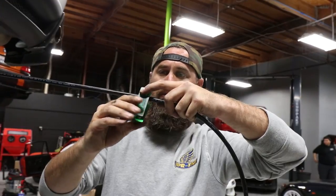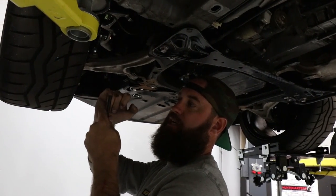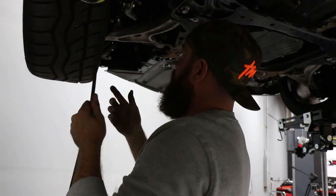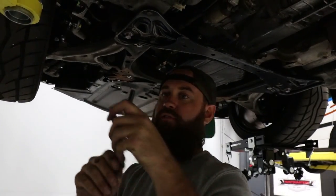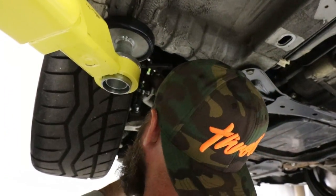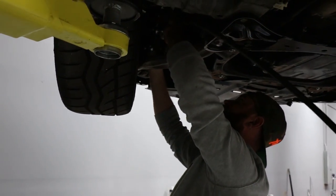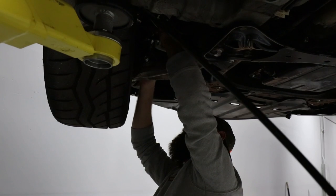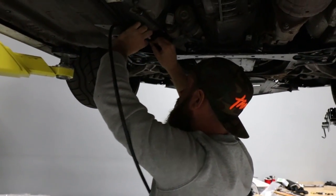Make sure your airline is cut with a nice 90-degree cut — no rough edges — because this can create leaks down the line. Use a cigar cutter or hose cutter to ensure a smooth 90-degree cut. Push the line into the strut and then loosely zip-tie it into place so that when you pull on the line you're not pulling away your slack.